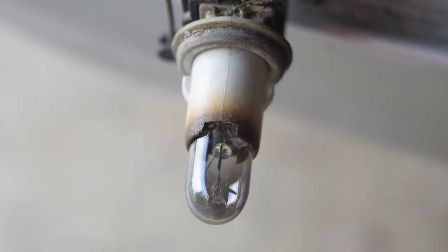Once you get access to the bulb, it's quite likely you'll see something like this — the bulb is darkened. That's because the tungsten filament, which is extremely hot, vaporises and deposits that vapour on the inside of the glass, so the light becomes much less efficient than it should be. Because of the heat, it also starts to damage the bulb holder, which is a good reason for using a much cooler bulb like an LED.